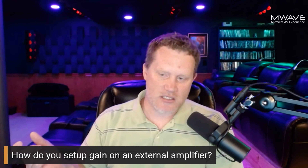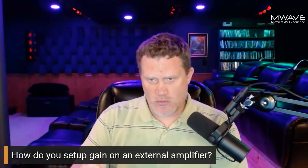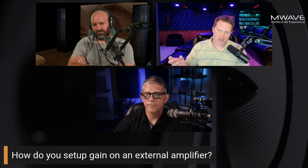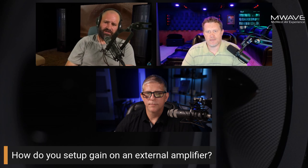A lot of people try setting their gain to 85 dB because that's THX reference, but with a consumer product it's going to be 75 dB. For Storm Audio and similar boutique units, I believe the test tone target is 85 dB because they don't have that internal offset. More expensive, boutique receivers are more in line with THX reference because they're not matched to cheaper speakers — and the expectation is they'll be professionally calibrated and custom installed.